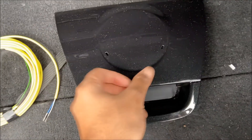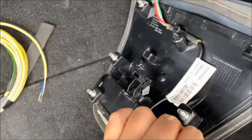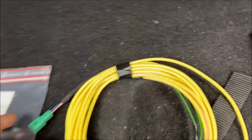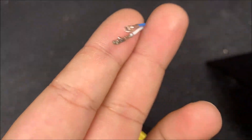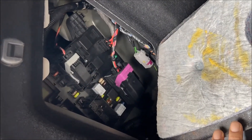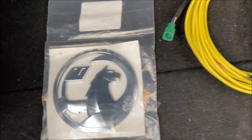We have our parts ready. This is the tailgate boot latch with the wire coming down to the camera. This is the wiring loom — this bit flexes up to the end on the latch, and these two wires go to the front of the car into the back of the head unit. The others will be the grounds and the wires going into the rear electrics module, plus a couple that connect in the boot latch. There's also a brand new emblem which will sit on top once it's all on.